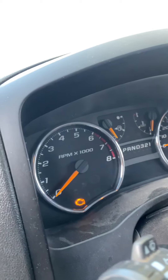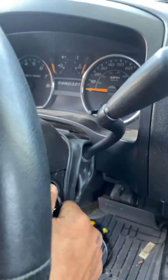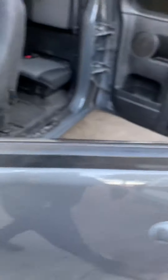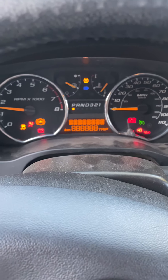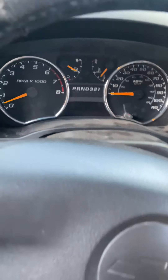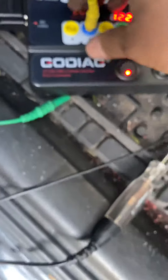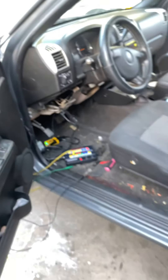Right here I obviously don't have any power. I try turning the key — nothing. And if I disconnect it, everything goes back, and then it turns on. So the issue we're having is the data from pin 2 of your OBD2 is shorting out to positive — to the 5-volt reference — which is causing the truck not to turn on.